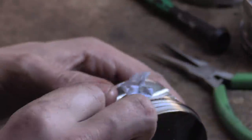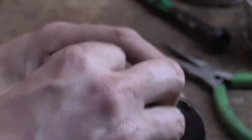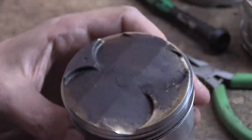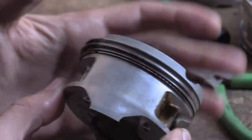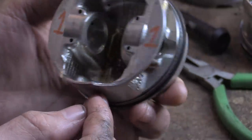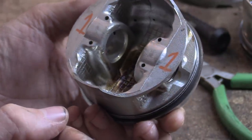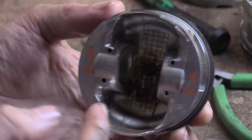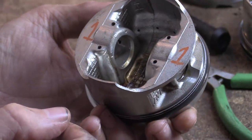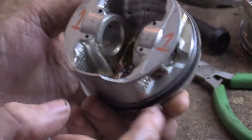The tolerance in this respect is what it can and can't take — like when something comes off a production line, they measure it and say can we tolerate it being that much oversized or undersized. Getting back to it: this piston is completely fine. The underside of the piston crown is one of the hottest regions, and you can see it's charcoal and cooked in there — that is normal.